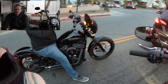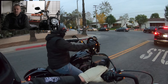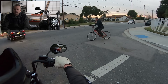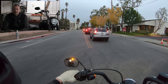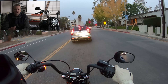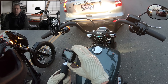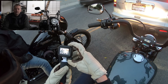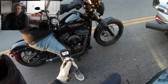Sometimes people think the single-disc brake on the standard Lowrider and the Street Bob isn't adequate. But they are adequate — you've got the four-piston caliper up front and the brakes work really well. The dual-disc brake is going to help alleviate brake fade if you're really going through the canyon hard, accelerating and braking in and out of every single turn. Most people aren't going to ride like that on a day-to-day basis, so most people aren't going to really see the full benefit of the dual-disc brake. The single-disc brakes for 99% of applications out there are going to be really good.